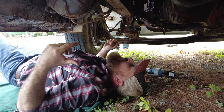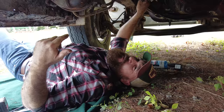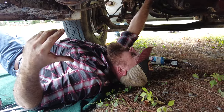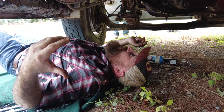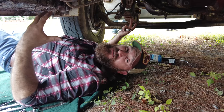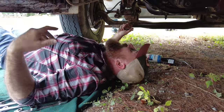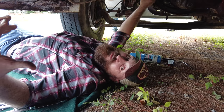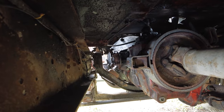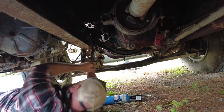It's not coming loose, the nut that holds the hydraulic line in. I'm not sure what it's called, but anyway, the nut that holds the line in, it's rounded out because it's so rusted. I'm almost wondering if the slave cylinder is okay, but I did just torch it. I probably should have tried putting some hydraulic fluid in and bleeding it just to see if the slave cylinder was okay, since we know the hydraulic unit was probably bad. But I easily could have just torched the O-rings inside of the slave cylinder, making it bad even if it wasn't. Yeah, I think I'll try to put some fluid in it and just see what happens. I have a feeling it's not gonna come off too easily.